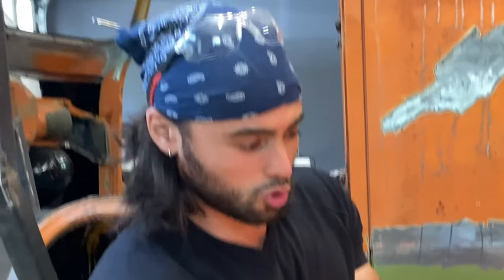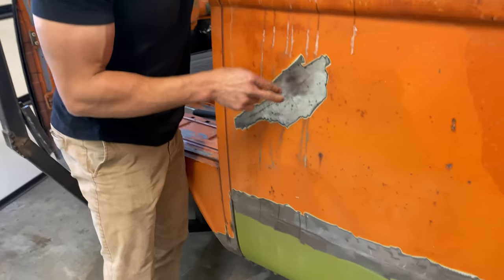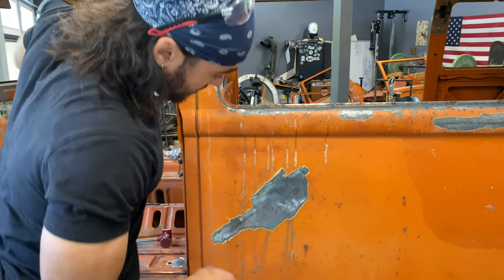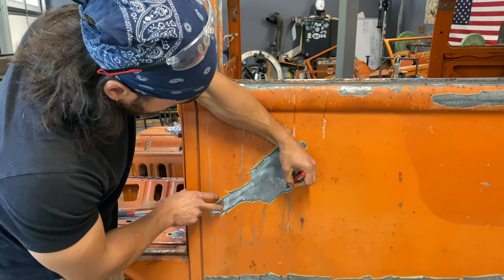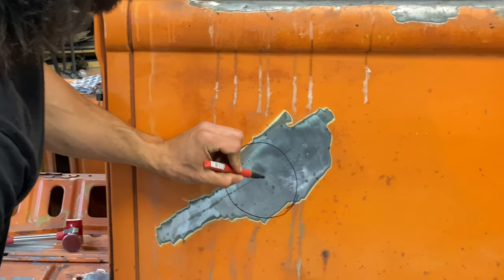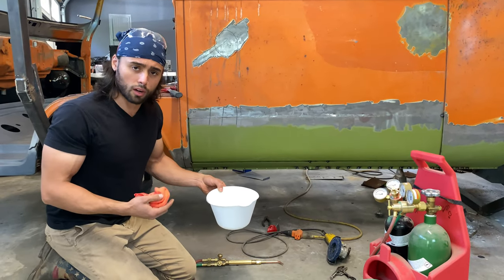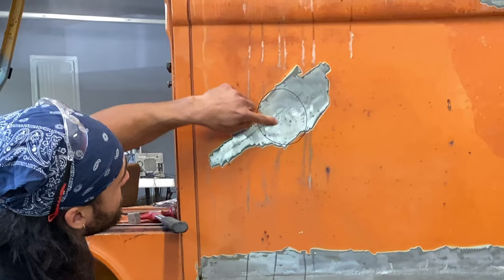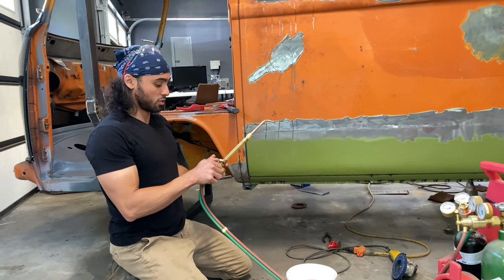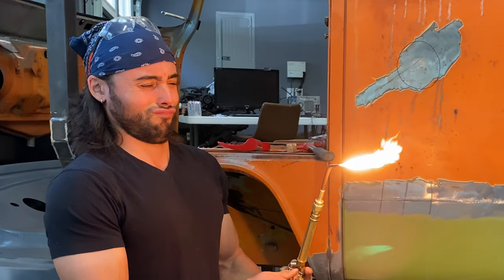How about we just use it... there we go. Let's not get ahead of ourselves. I think I might figure out how to use the torch now. We've got to find the center of the situation — we're going to start here. We're going to shrink maybe right there. Hopefully I don't just blow straight through. We've got our bucket of cold water, our wet rag. We're going to heat a dime-sized area and then attempt to shrink it.